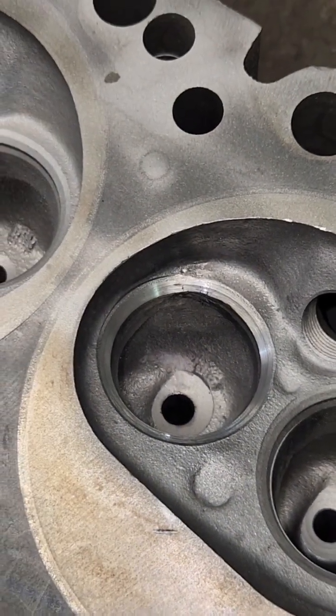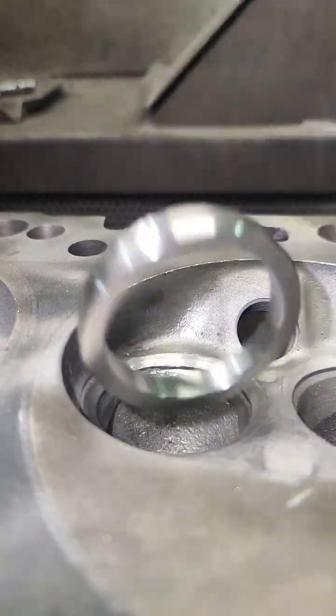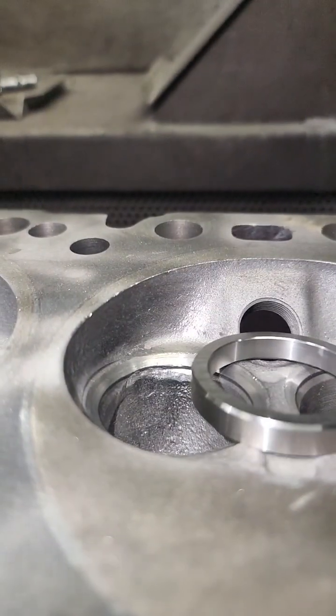Tomorrow I'm going to be throwing a set of hardened exhaust seats in this cylinder head. I've done a lot of crack repairs just like this over the years — a truckload of them. A lot of Vortec heads, a lot of 5.9 Magnum heads, four liter four heads, quite a bit of blocks too. I've done a lot of small block Chevy blocks — they crack sometimes on the outside, just real minor repairs, nothing crazy.